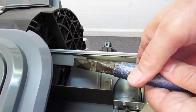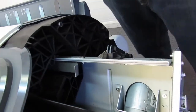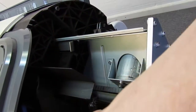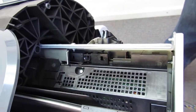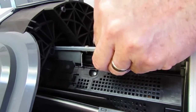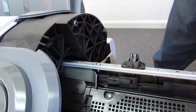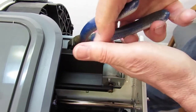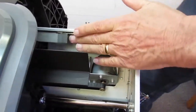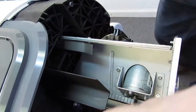So I'm going to get a hold of that with a pair of pliers here and bend that up. I'm not going to hurt anything — we're going to put that back before we're done, but that makes things a lot easier. Now I can bring the carriage back over and you can see there's where the clip side goes and that's where the other side of the bushing goes in. So I'm going to do the clip side first. Just stick it in the hole and I'm going to flex this a little bit so it goes into the other side — and it's in. That's all there is to it. Now the purpose of this is just to guide the bushing into the channel underneath. It doesn't have to be any exact angle, just so the carriage isn't bumping into it or anything.